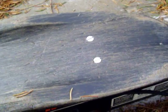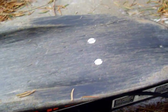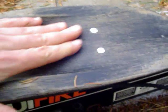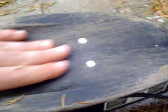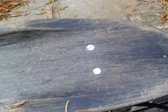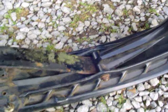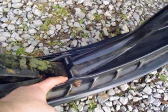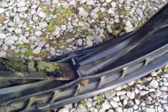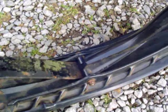Once you get the rear spring mount located where you want it, I use some flat head machine screws and counter-sunk the holes a little bit, so you get a nice smooth transition over your attachment point there. You'll have to stack some washers or make a spacer in between here, because there's about a quarter to three eighths of an inch gap that the leaf spring will move back and forth in if you don't take that up.